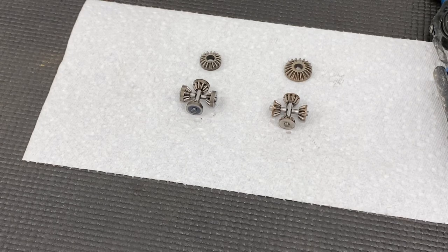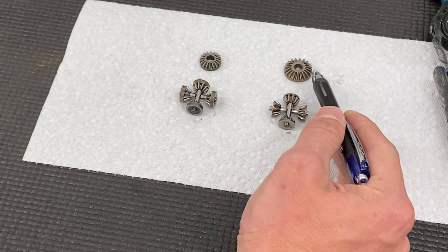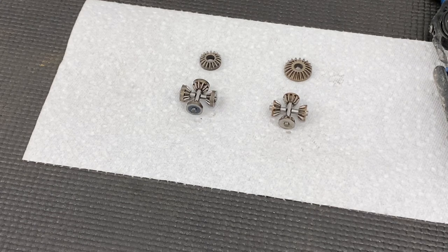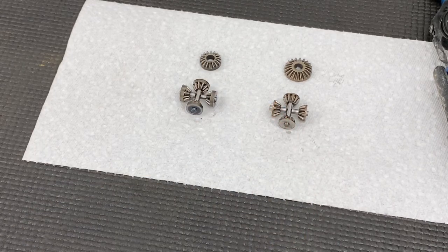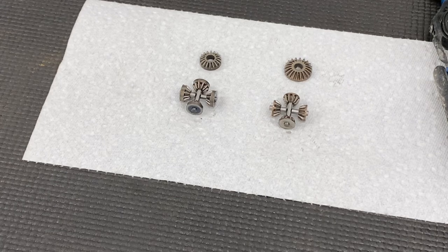So what does it all mean for the car and how it performs? With the HTC you're going to have more surface area, more tooth engagement, and basically a little bit notchier of a diff than you would with the LTC gear diff. Another way to think about it: HTC means high traction condition.